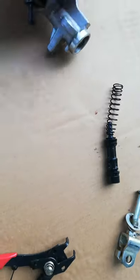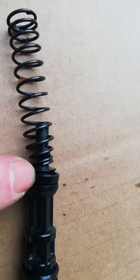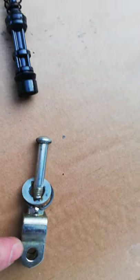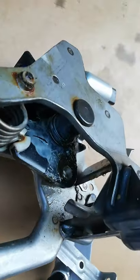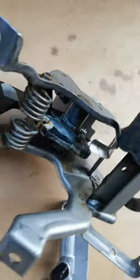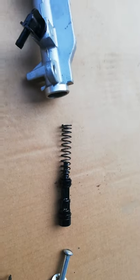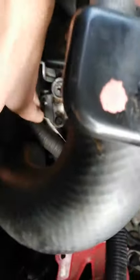The components are: piston, return spring, first seal, second seal, plunger push rod — which clips through the pin and circlip. That's difficult enough out here and very difficult in the car. The slave cylinder is comparatively a dream — it's just down there, two nuts and out she comes.